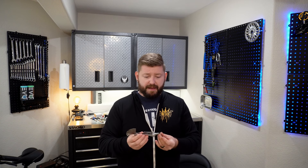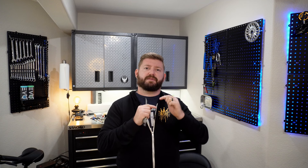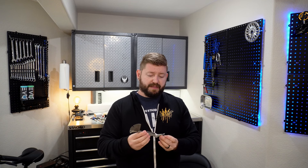One of my all-time favorite tools are feeler gauges. In the automotive world we use them to check lash adjustments and spark plug gaps. For bikes, I use them to check tolerances quite frequently, as well as preload on hubs and different bearing assemblies, and to double-check that things are properly seated without too excessive a gap underneath. For the price — maybe $10 — get a set of feeler gauges. They really might come in handy.